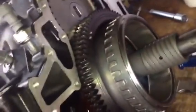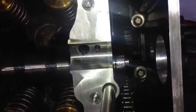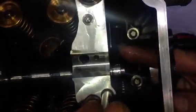So the timing marks that we spoke about are now in place again, automatically. Now we're going to move to the camshaft. Push in your camshaft, then you'll see there's a lock slot right there. So with the lock slot in position, we're going to use an 8mm shaft tool — stick it in there, and now the camshaft has been locked down. Make sure it's locked into position.